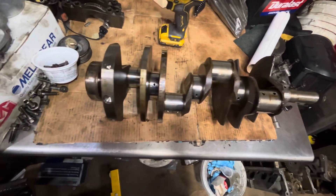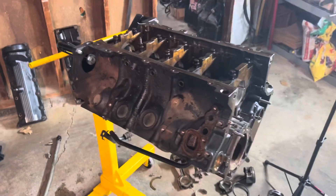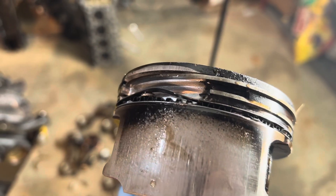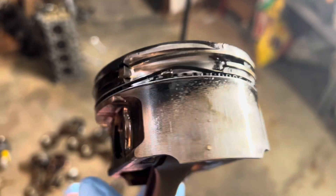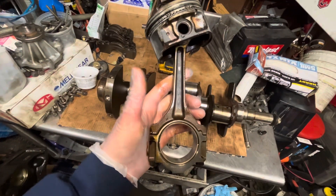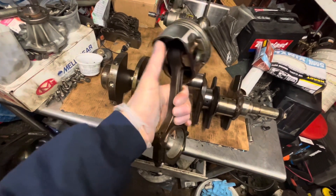After taking a look at this crank, it's actually in pretty good condition — some minor wear at the bearing locations, but nothing that can't be polished. We're down to the bare block. So that was the piston that was causing the cylinder to lose compression. I guess the kid was telling me the truth, even though he thought it was piston rings when really it was a damaged piston. The rest of these rods and pistons are in relatively good condition and could definitely be used if you were intending on building a stock engine.